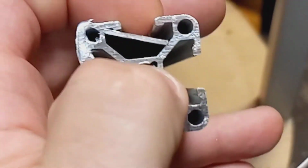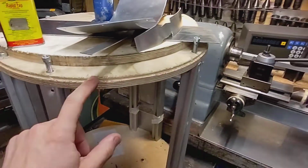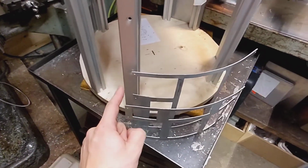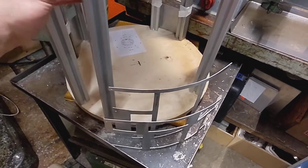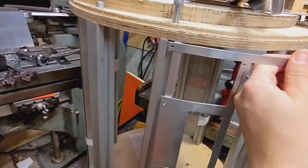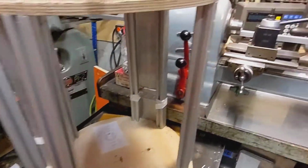So I have these inserts that I can just make, the whole length of the thing. And it's going to go in. So I'm replacing this. Figured out a little bit more of the angles now that I did a full mock-up. Some of these things, they don't matter where they terminate. But I want to be able to butt other pieces of sheet metal up to other sheet metal. So I want a floating nut that kind of covers this, and then maybe one that goes on top that holds it captive.